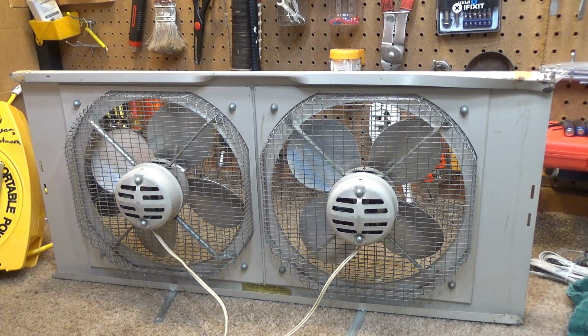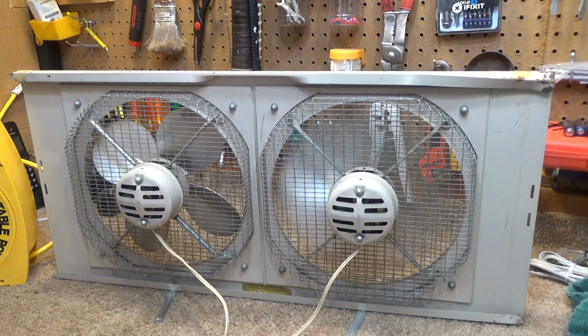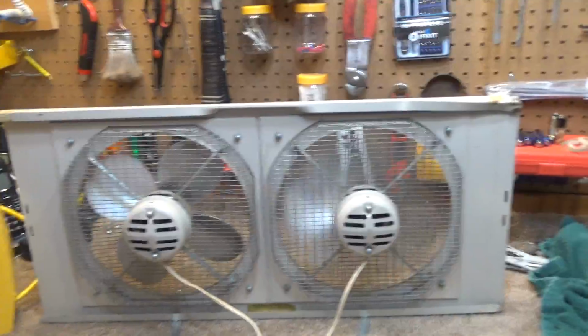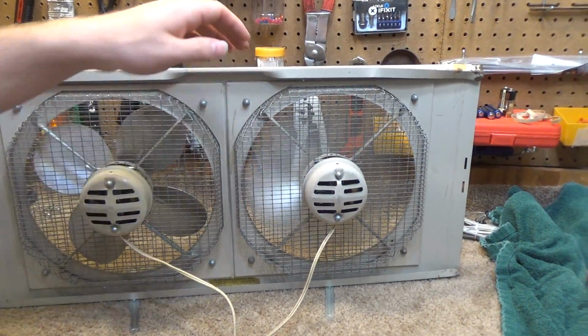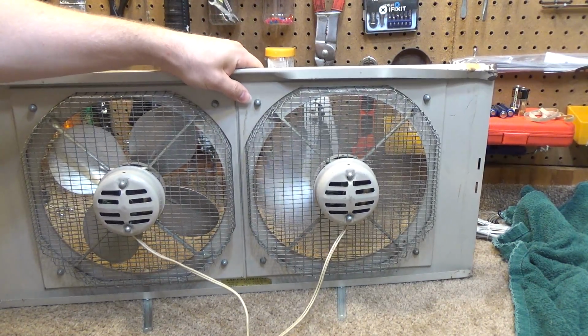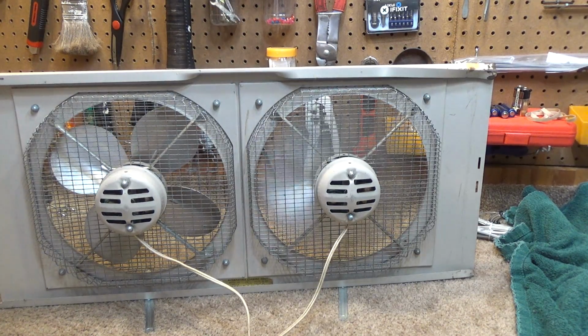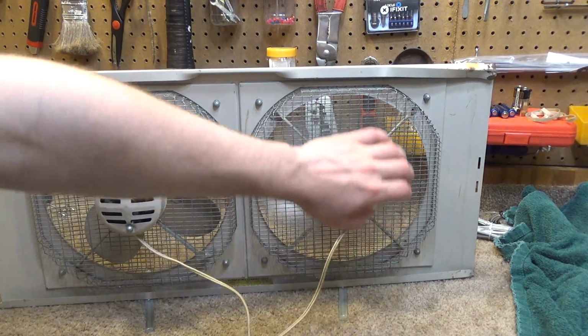We're testing at 121.2 volts. Go back to amps. And we'll start it up on low. As you can hear, it's vibrating immensely. I'm not exactly sure why it's doing that. It's drawing 0.65 amps, so pretty close to what it should be. And hopefully you can hear in the video, it has a pretty distinct metallic-y sound to it. Moves a lot of air.